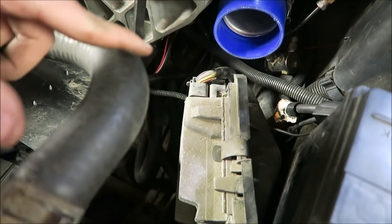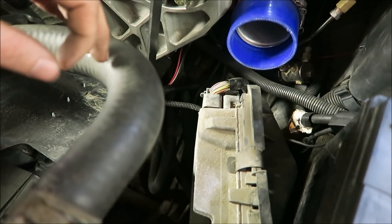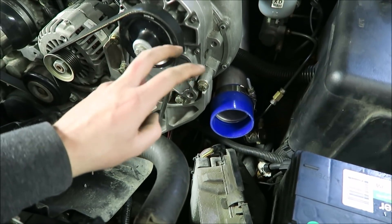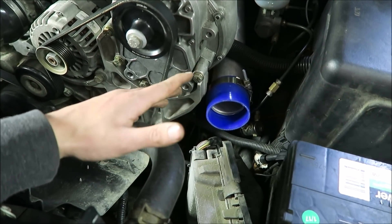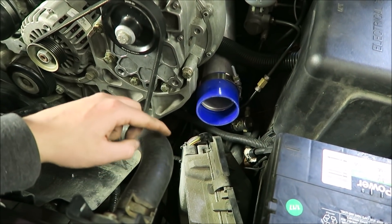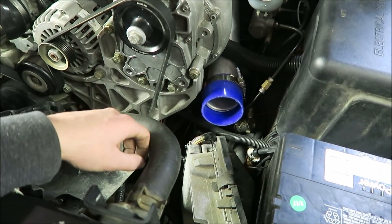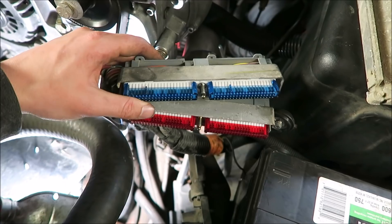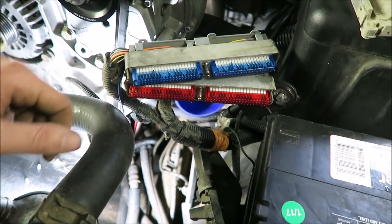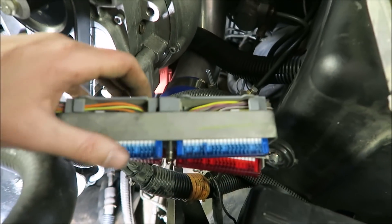Now that we're up top and can actually see the ECU and the connectors for it, we can repurpose those wires we used for the speed sensor — the white one and the black-and-tan one. The white wire is pin number 79 on the C1 connector, the blue one, and we need to move it to pin number 22 on the red or green connector depending on your year. The black-and-tan wire will already be on the C2 connector and we need to move it from pin 42 to pin 23, still on that C2. Just one quarter-inch bolt to unscrew and the connectors unplug. I had to take the computer out because a brake line was blocking the red plug from coming all the way out.